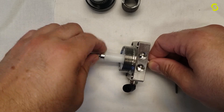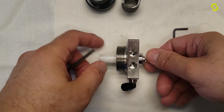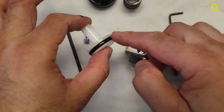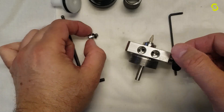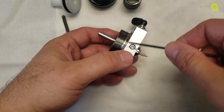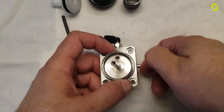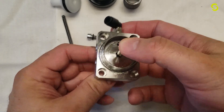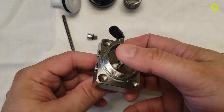Take your wrench and hold the piston — it should be relatively loose, just snug tight. If it is tighter due to Loctite, you'll need to secure the needle while unscrewing. Once removed, take out the piston. You'll see there is a seal on the piston, and the screw has a small seal as well. To remove the needle and cartridge assembly, use the 2.5mm wrench to unscrew the set screw. Then carefully push the needle cartridge assembly out through the front.